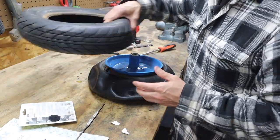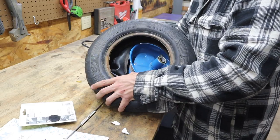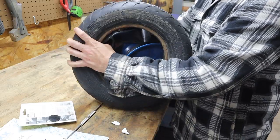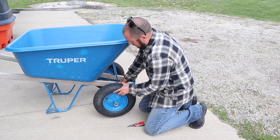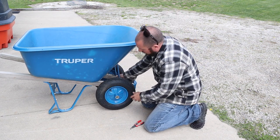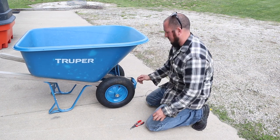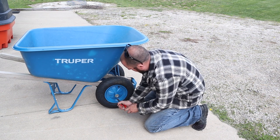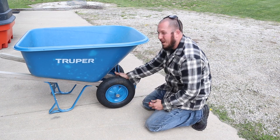We are ready to put the tire back on the rim. Go ahead and stuff our tube inside the tire here and move this around as we go. Ensure that your valve stem is on the outside when putting it back on. You want to have a topic of discussion? It's called a wheelbarrow and not a wheel barrel. Slide your cotter key through and wrap it around here. Split it so it can't come off, and we are back up and running.